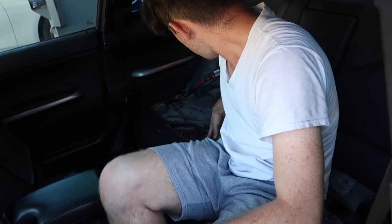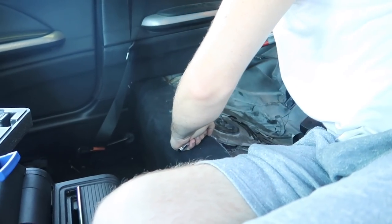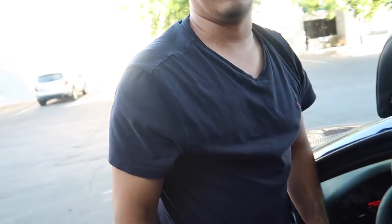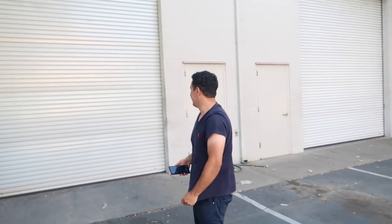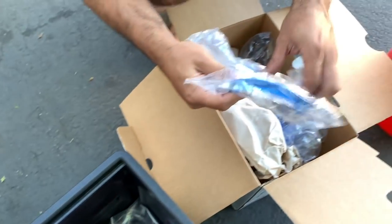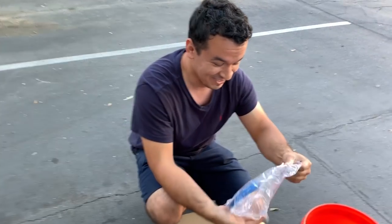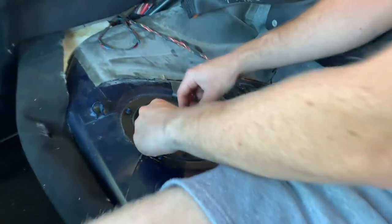We tested the prime — nothing. We didn't hear anything at all, so yeah, it's the pump for sure. With a new pump you should be able to hear it priming super loud. We're doing the replacement right in front of the shop. The pump came from FCP Euro and has clearly never been replaced — it's so dirty. This is a BMW fuel pump kit.